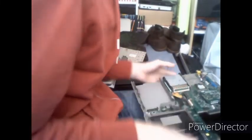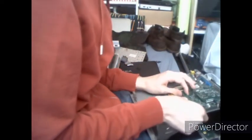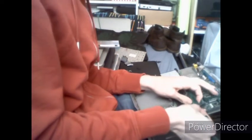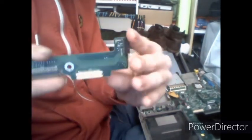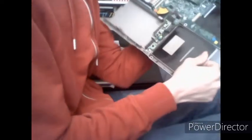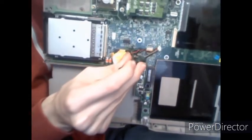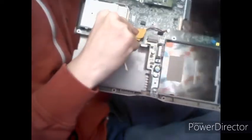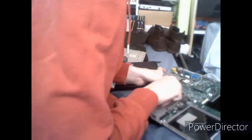component. Now, on my computer, to get to the CMOS battery, you want to pull up on this interconnect board here, as it's connected via a little edge connector right here. And then the BIOS battery connector is located right here. And here is my CR2032 package that I custom made. And it's doing its job at keeping the computer's date and time set.